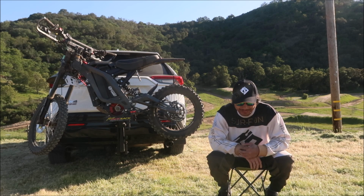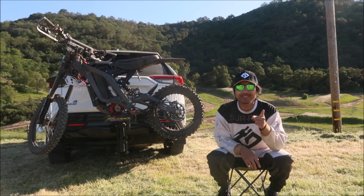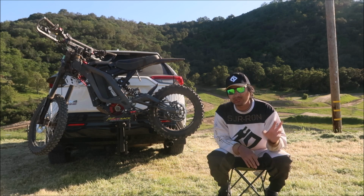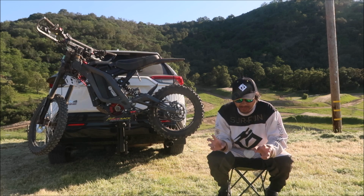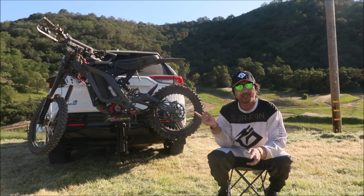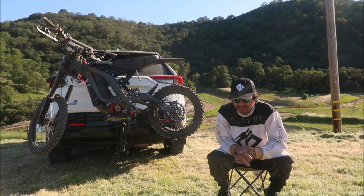Anyway, so the first lap rolls along. At the end of the first lap, I was like, man, this is a long course, and there were a lot of sharp turns. I had to use that rear brake a lot, man. And another thing is the front brake, I started losing pressure on it. I was like, oh shit, I know the pads are fresh on it, so I think I gotta bleed the front brake, man. I gotta bleed all the brakes again.